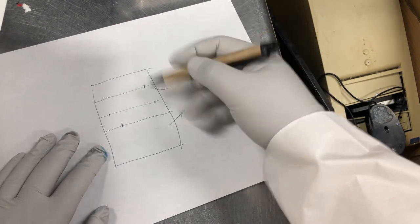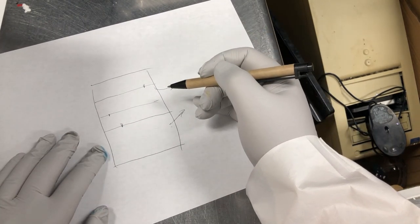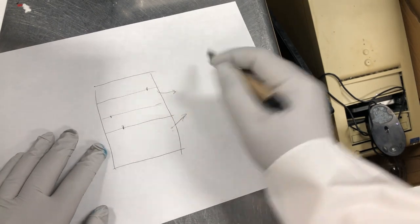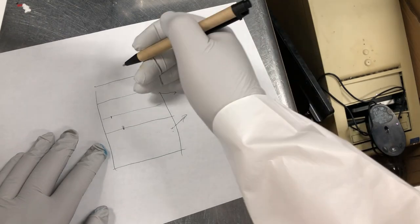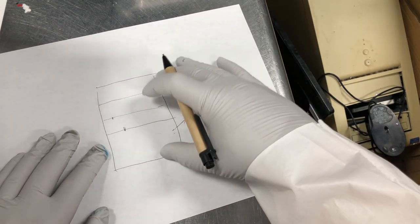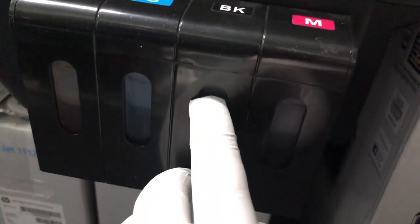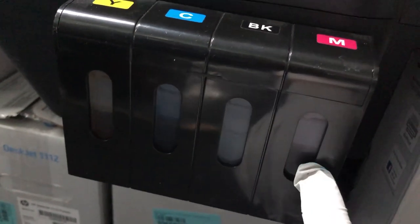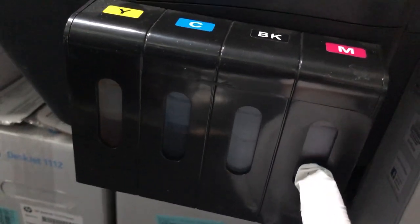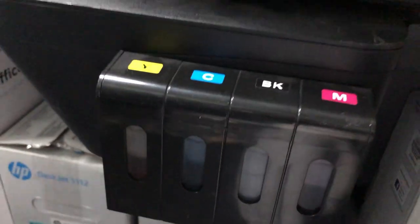And so you can see this kind of design also depends on where you put this tank. So this printhead right here has to be within this range. Here's an example of the chamber design. If you look closely, you can see there are horizontal lines of the chambers. So when the tank holds more ink, you're going to see there are more chambers underneath.